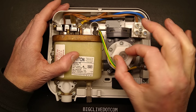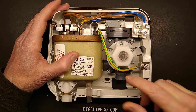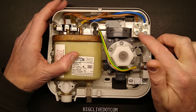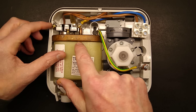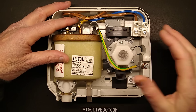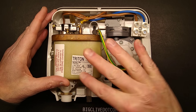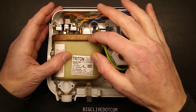The water comes in and goes through this regulator valve, which is basically a tap effectively. As well as diverting water in here, it diverts it up to this switch. You've got the live coming in here, which goes through this over-temperature cutout switch and then to the micro switch, and then it comes back to the heating element. The neutral goes straight to the heating element. In here is a coiled heater, fully enclosed in copper, and everything's well grounded.